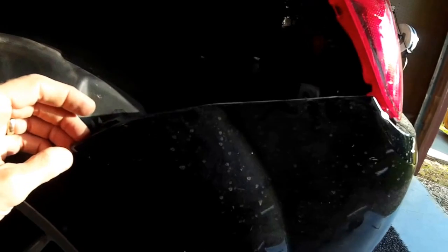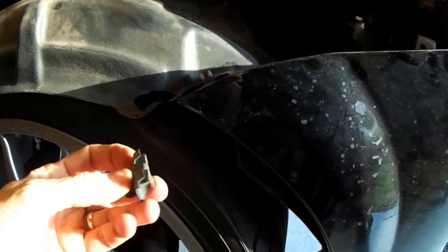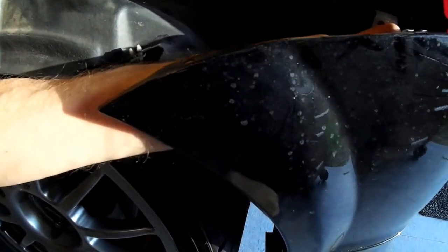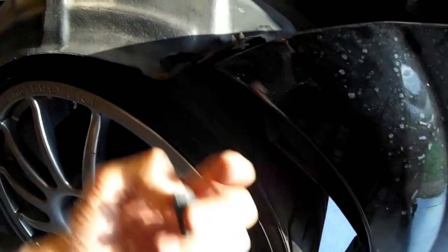This rear bumper skin, I don't know if you've seen these little clips before. That's what holds it. It engages that little tiny hole right there. There's not much to it, but usually by the time you take this one screw out, reach a 10mm straight up through here, you can get that one. Take that loose in the fender and then just jiggle it, and it usually pops out of this little clip, which was attached right there.